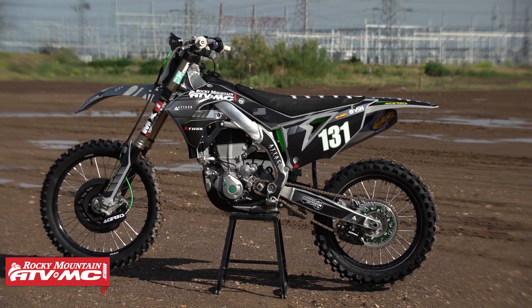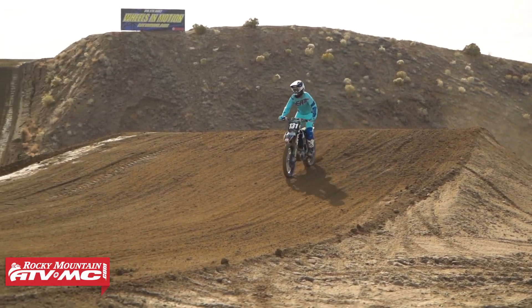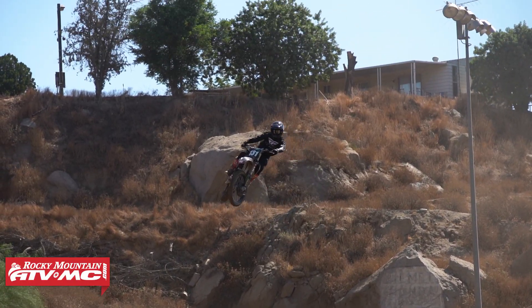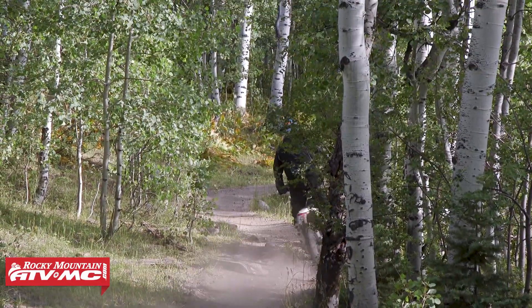Let's give a few scenarios. On my 19 KX450, for example, I have a 37.5 reel — that's what mine is stock. When I twist my throttle at 50 degrees, my actual valve on my throttle body is going to be open about 75%. But if I were to take the 50 millimeter reel and put it on my bike, when I twist my throttle the same amount — 50 degrees of rotation — I'm actually going to be at wide open throttle. The lower the number, the more mellow your power delivery is going to be, because it makes you actually have to twist the grip more to get that valve to open up the same amount.